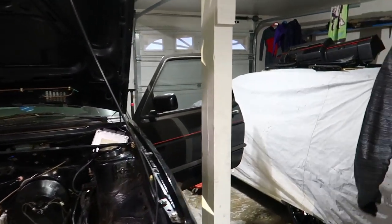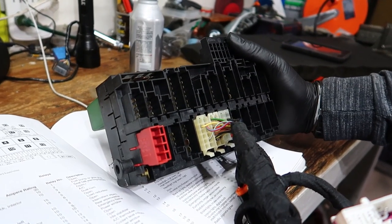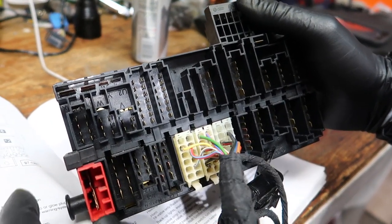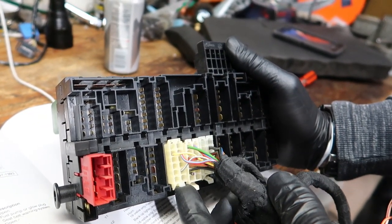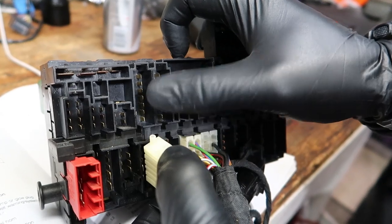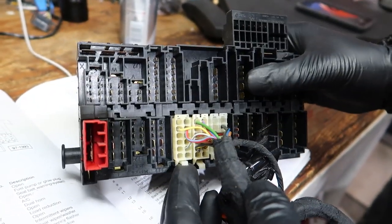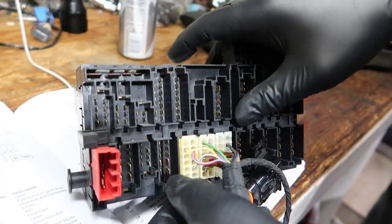We're going to undo some from the CE2 box for you guys. First thing I'm going to do is unlock it, right here. All it does is slide that over. You'll see the little pin: instead of blocking that little guide pin, it locks it. Unlocking it lets you press this at the bottom, which unlocks that plug, and then it's able to pull out that top pin. If this is slid over in the lock position, I can still pull this, but it's not going to come out because that pin is in there. So you unlock that, and pull it out.